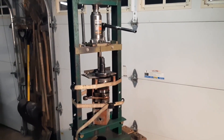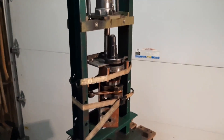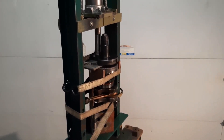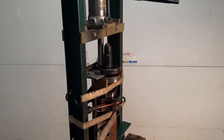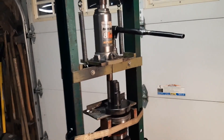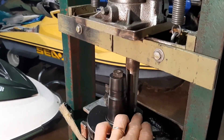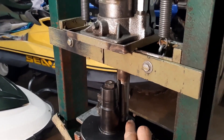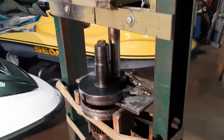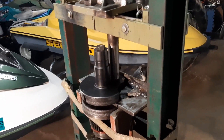Here's the setup for our crank pin pressing. We've got the crankshaft in the fixture and basically we have an 8-ton press. We're going to heat the counterweight around the outside of the crank pin here and we'll probably hit it a couple times right there with the mallet.